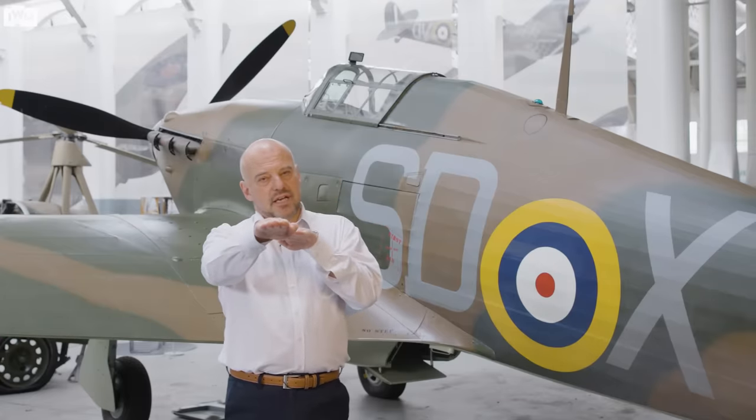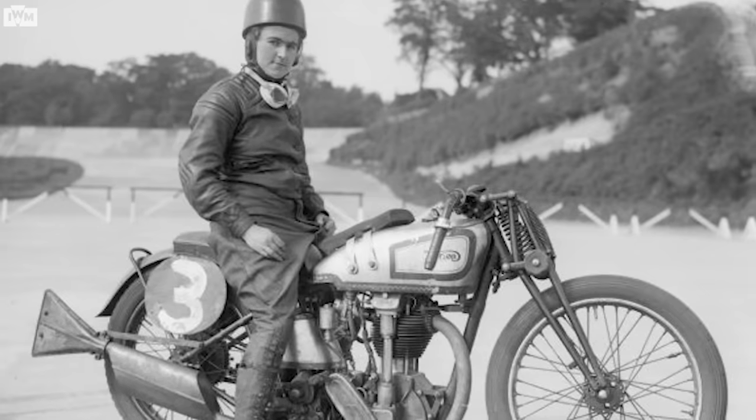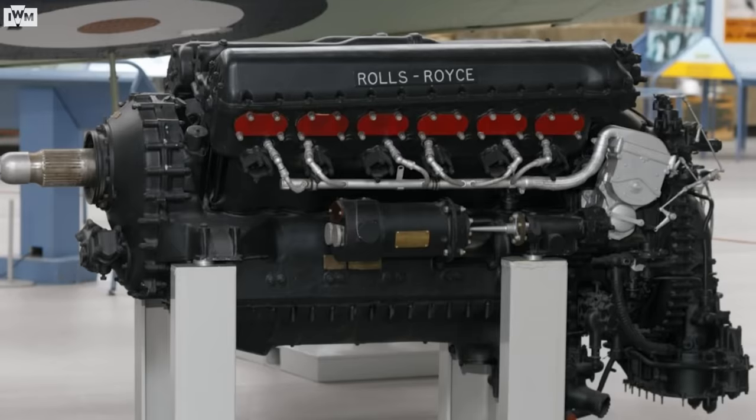If a Spitfire or a Hurricane was chasing a Messerschmitt 109, the 109, with its fuel-injected Daimler-Benz engine, could push its nose into a negative-G dive. The arteries in the Luftwaffe pilot's eyes might pop, but the Spitfire and Hurricane could not follow. If they did, the carburettors would flood and the engines would cough and splutter — not a good situation in a dogfight. The 109 pushes its nose over, and the Hurricane or Spitfire has to peel over the top to keep the flow in the carburettor at positive G. This problem wasn't cured, but it was certainly helped by an extremely clever lady called Mrs Beatrice Schilling, who came up with a design — a washer-like orifice — to put inside the carburettor and squeeze the flow of fuel, giving the carburetted engines a much better chance when touching a negative-G manoeuvre.